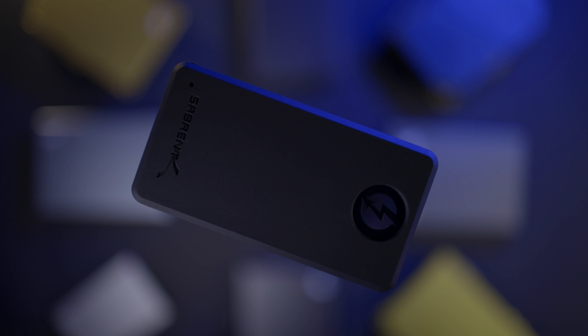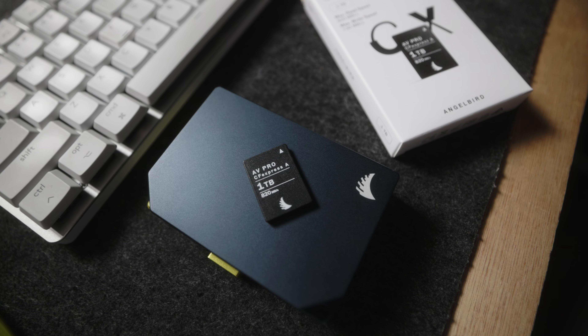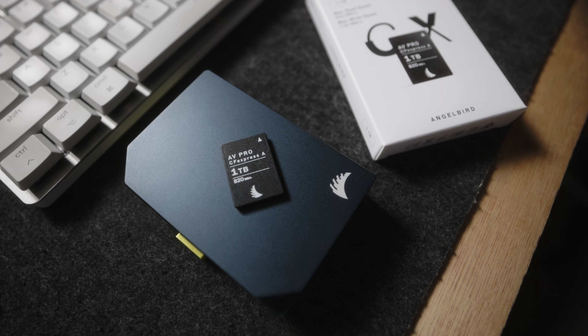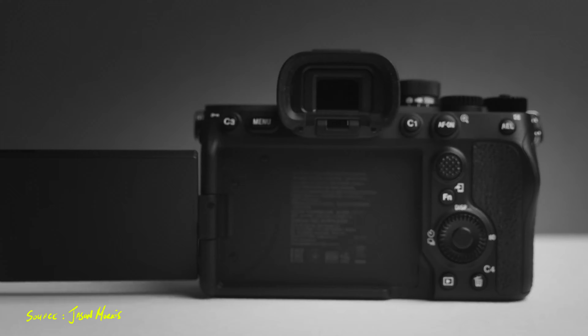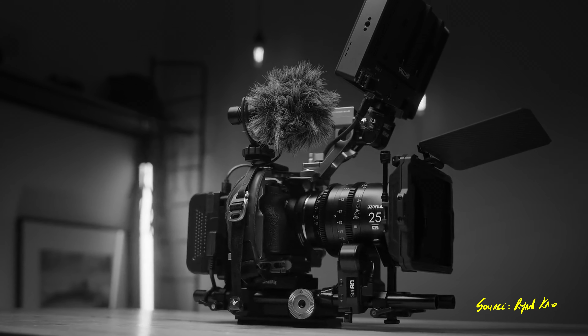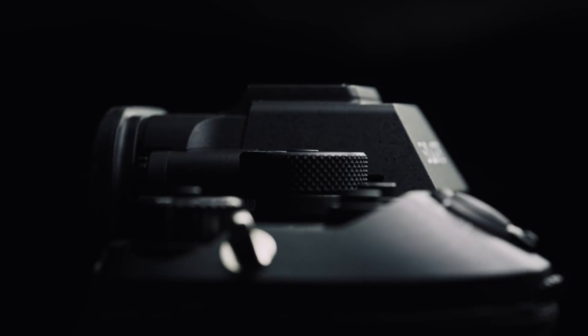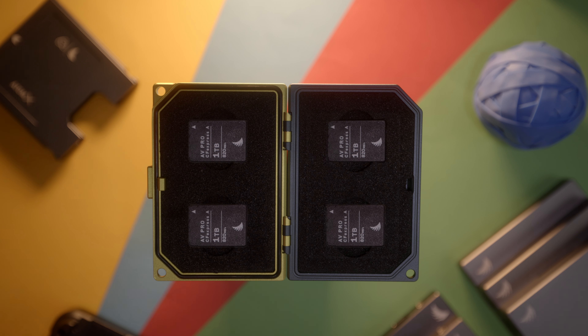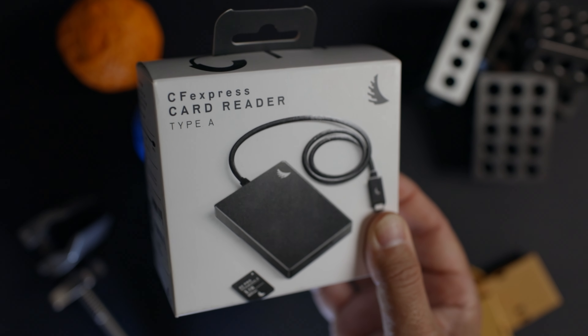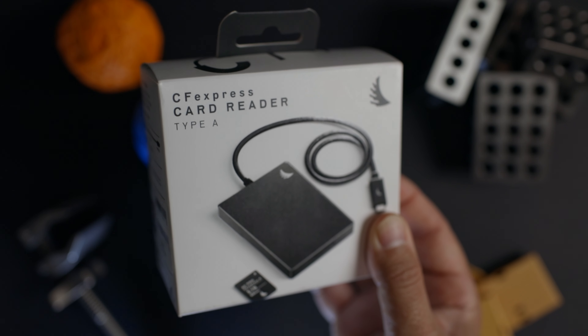There's a lot more to download speeds — like your overall system — than just moving to a Thunderbolt connection. The big drawback of these card readers is the format they're designed to support: CFexpress Type-A cards, which are limited to a selection of specific Sony cameras. But seeing as the new Sony A9 with its global shutter — which on paper looks like a stellar hybrid camera — still uses CFexpress Type-A cards, and even though Sony's current media card implementation is looking like a bit of a mess, I think it's safe to say this format is going to be around for some time. So these card readers are still a safe purchase.